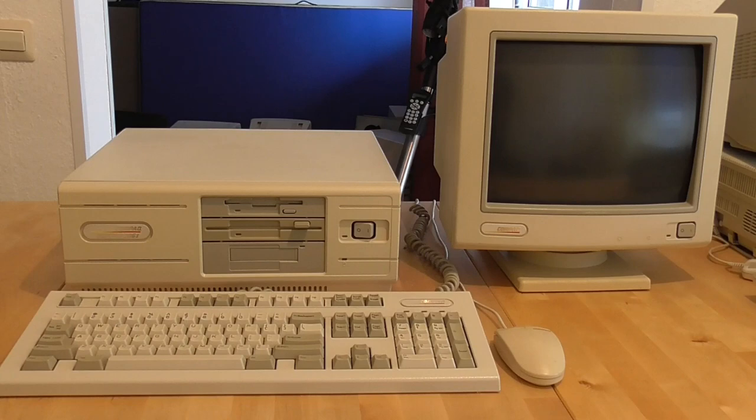I've also purchased a Dallas real-time clock, so we'll finally be able to put the hard drive settings in permanently. The more interesting thing I want to do is check out the main board in the other machine — the one in this machine is slightly unusual and I can't find any diagrams that match it online. I want to figure out whether that's genuinely unusual or whether the diagrams are just incorrect.